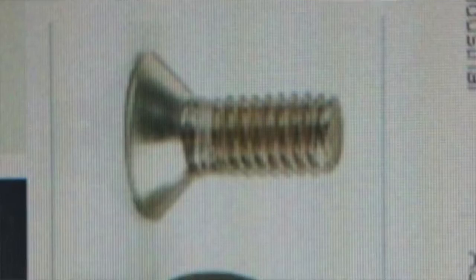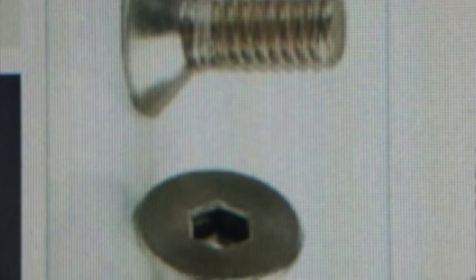I was texting a friend talking about the hardware on this power chair. Instead of making my own custom hardware, he reminded me that they sell tapered bolts that should be self-centering. So I'm gonna go over to Home Depot and see if I can find some, because the squeaky, crunchy, weird sounds came back. The proper tapered bolts should keep things from shifting and making those weird sounds.